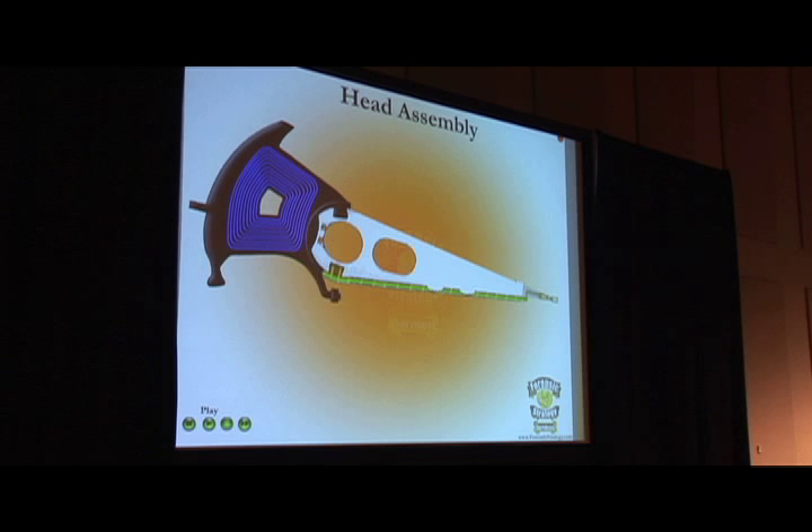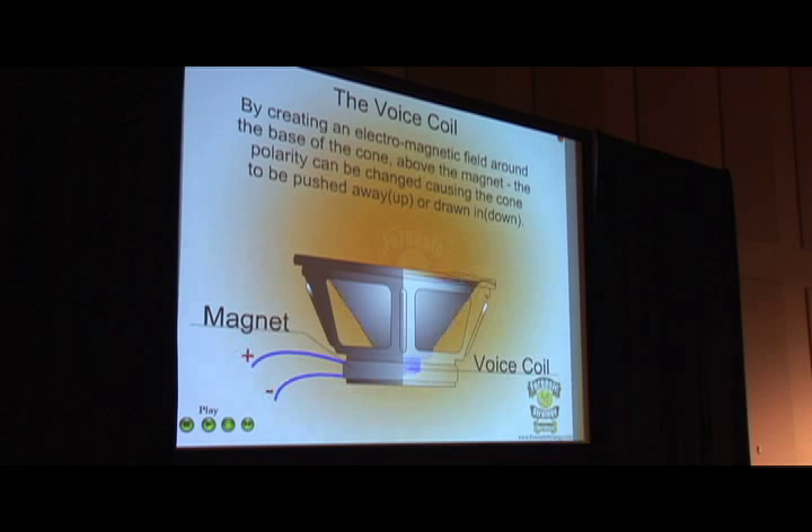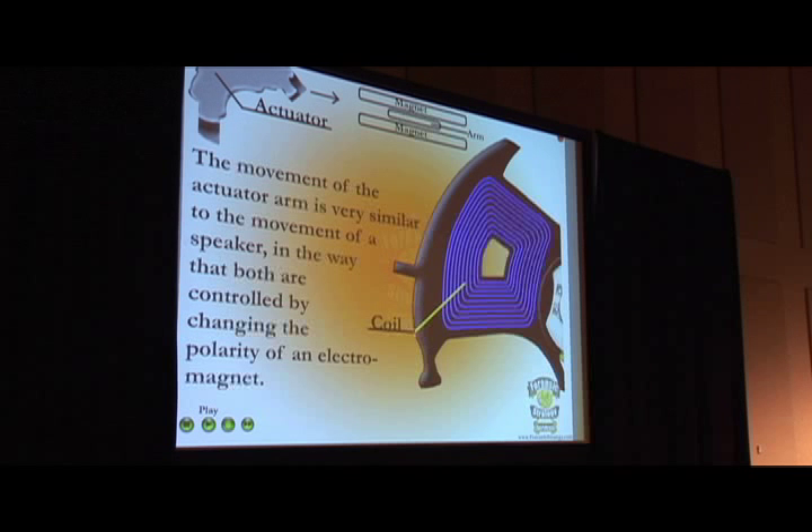The arm of the hard drive is manufactured so that wind resistance is what helps it float — that's why it looks like the wing of an airplane. Everything on that arm is optimized for speed to keep it floating, including all the holes cut in it. The triangle piece was cut that way for strong rigidity while still being light enough to be lifted. Every hard drive uses a voice coil today. At the end of the arm, the voice coil uses resistance like a speaker — when you supply energy to it, it causes movement back and forth in very small areas. That's why they needed servo information — to track where the head was, since unlike a stepping motor that moves in set increments, a voice coil doesn't, so they supply small amounts of energy for small increments and then confirm position.